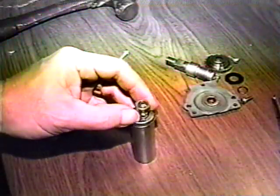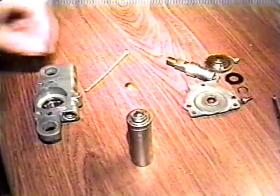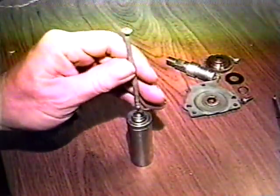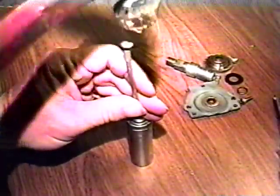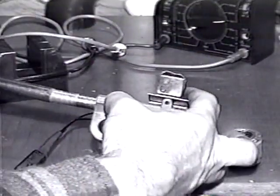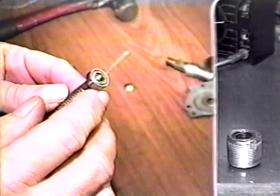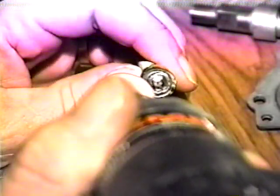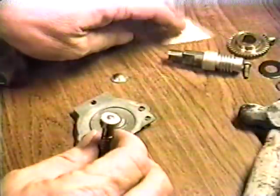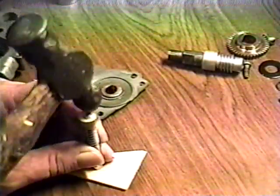Now you can remove the old bearing. Some are just pressed on the worm gear shaft and can be easily driven off. From a deck lock screw, and since the flexible drive shaft is just slid into the transmission casing, the end of the worm gear shaft is peened over to keep the gear from backing out. To remove this bearing, grind the peened edge off just enough so the bearing will come off the shaft. Clean up the worm gear and install a new bearing. If necessary, repeen the end of the shaft.